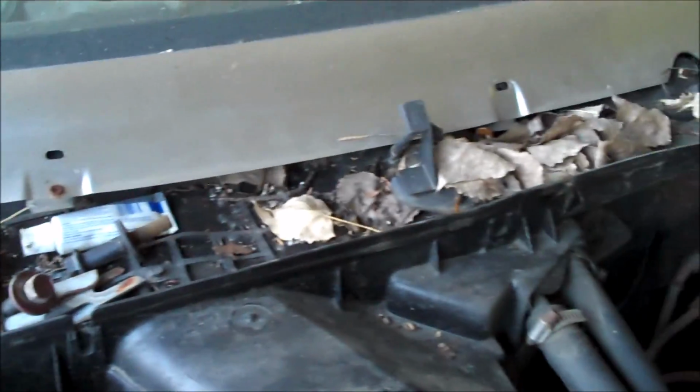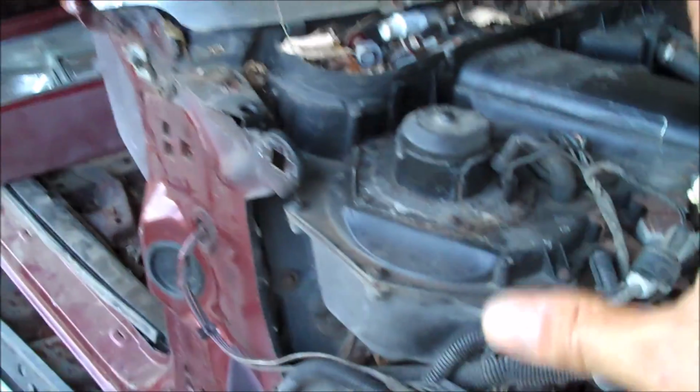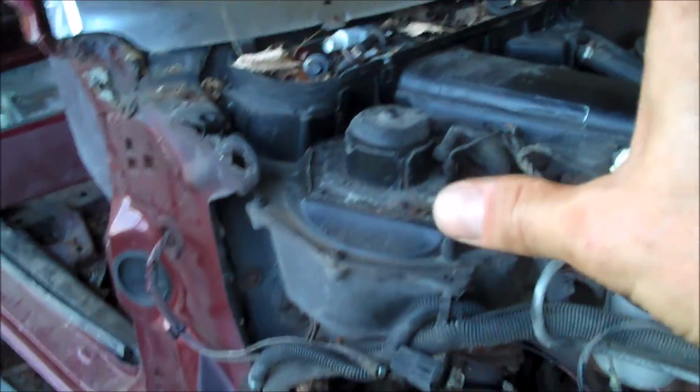Thirdly, you have all this going on up top here. Go ahead and get rid of the weather stripping. You have a screen. You have the windshield wiper arms that'll have to come off. You have this piece of chrome here that'll have to come off as well. That's because there are several bolts hiding behind this piece of chrome that holds the heater box to the firewall. And you can see the bolts that follow along. There's one hiding up in there. They run down here, they run across the bottom as well. Now, once you get all of that undone, you are pretty much set on the exterior.